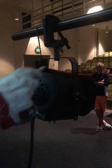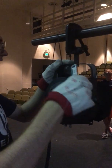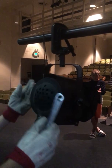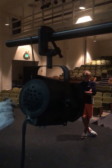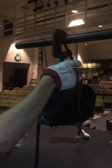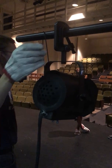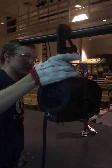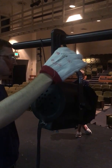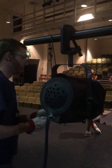And there's a couple different bolts here. This one keeps this housing attached to the clamp. If this gets loose, it can rotate because it's not holding on. And your lights can rotate that way, but if this stays loose, it will actually start to wear out the thread on it until this clamp becomes useless. Don't let it get to that. Additionally, if you just have these ones always tight and just deal with the F-nut, it's much simpler for people to remember, like, it's not moving, and they loosen up everything, and then it's a problem.